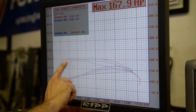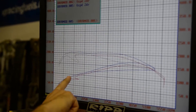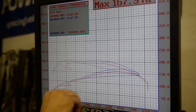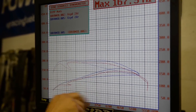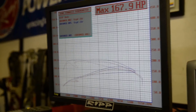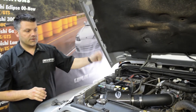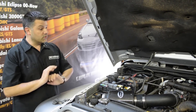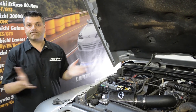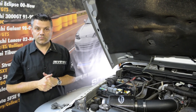She fattened up on the torque side — she's right above the 200 mark, just under the 205 mark maybe — and you can see this blue line is skating well over the red line. The red line is basically the stock pass that we made before. We did a couple of passes in between to make sure she was okay, and now you can see that she's cooled off. In naturally aspirated situations you want to try to get what you can out of it, and that's for better or worse what you'll be getting. So what we've proven here is that you take a bone stock JK — a 3.8 liter 6-speed on a 31 inch tire — you don't do anything else but put our air filter system on it and you find just about 10 horsepower. Next modification will be electronics, and then we'll move on to exhaust systems — so next time I see you we'll have some electronics in here.